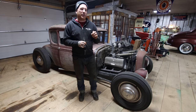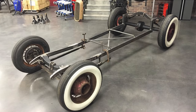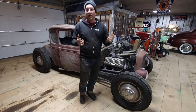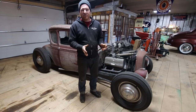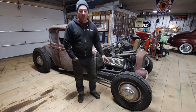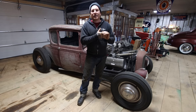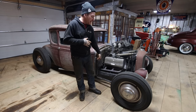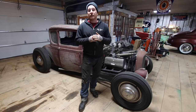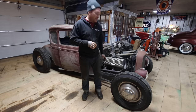This car is channeled about five and a half inches. The roof is unchopped and the frame I actually built from scratch using box tubing — you could use a Model A or 32 frame, whatever you'd like. I tried to make the frame look like an original frame as much as I could, so I put Model A front and rear crossmembers and welded on the front Model A horns. The frame has been stepped in the rear about nine or ten inches, and in the front I have the frame pie cut so it kind of sweeps up.